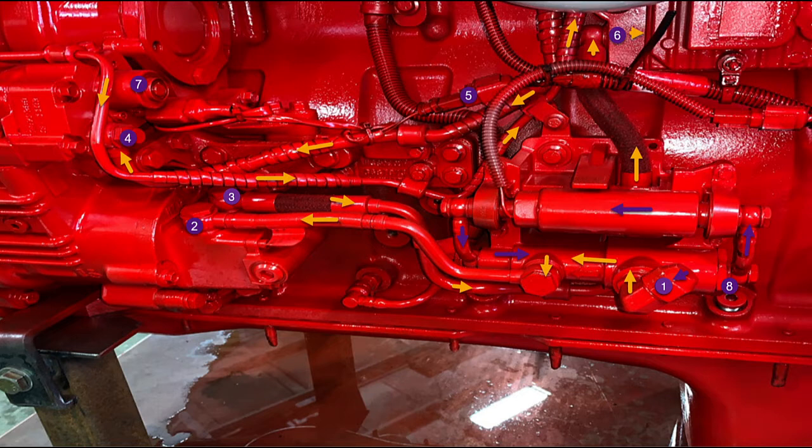Number seven is the fuel actuator, and it is a feedback system. If you look over to number five, that's where the actuator pigtail plugs into the engine harness. The ECM will monitor fuel pressure in the rail and uses a feedback system to send pulse width to actuator number seven — you'll see a picture of that a little bit later. That controls how much fuel pressure the high pressure head can build. It doesn't control it by dumping high fuel pressure; it controls it by the amount of fuel it allows into the pumping chambers on the high pressure head.